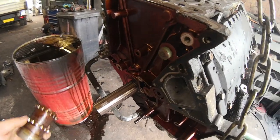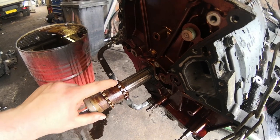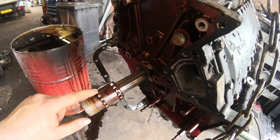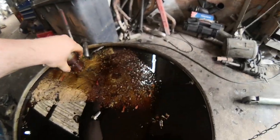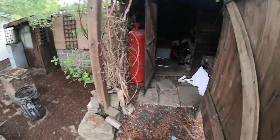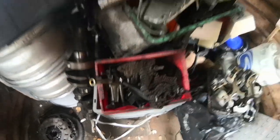So one of the things we have to change on the M62 - obviously that sits on there and then on there on the keyway. The single row timing chain, single row oil pump - now that's the same on an M60. On an M60 this here is twin row, so we've had to use a three-leg puller to pull that bit off. We've got to go back to the house to get the M60 crank. There's an M60 crank - we'll have that. We'll have this box that's got the oil pump and stuff in it, we need that. Need the sump but that can stay for a minute.